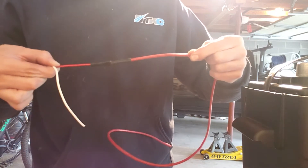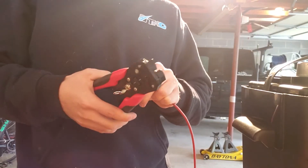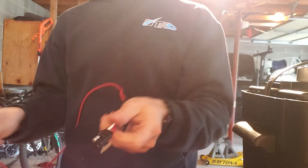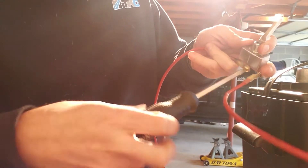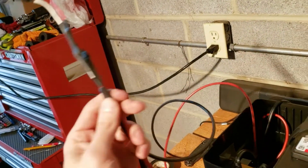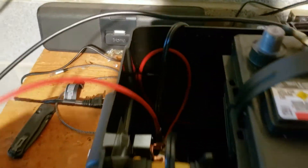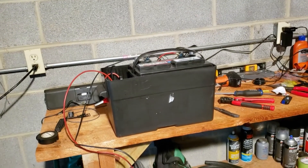There's our connection. Here's the pump side - this goes to our switch. Now we can mount our switch back in the box. Everything else we do is going to be outside the battery box. Both wires are hooked to this connector - I did the same thing we just did with the ground wire, and that's running to the battery. I'm going to throw some wire loom on this so it stays tidied up, and then we're going to move this whole thing over to the truck and start hooking it to the pump.